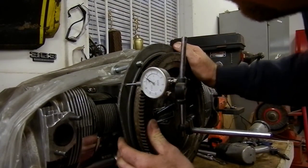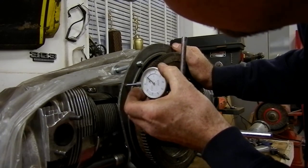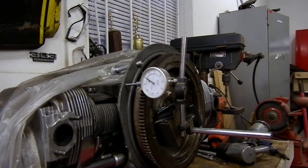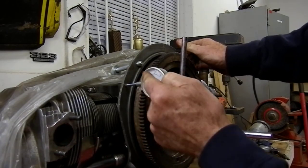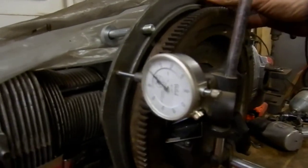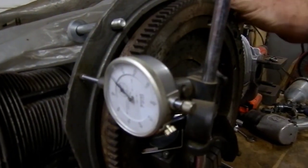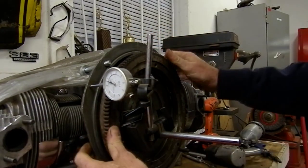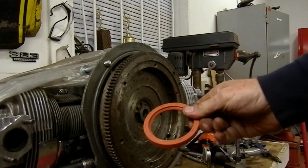I'd mentioned in class that I had done this and said I wished I had a camera, so here I am redoing it just to show what I found. It was textbook — the clearances I set the engine up for worked out exactly as intended. I wanted three to five thou of end float, and I'm at three thou. Before, we were moving all the way to 33 thou; now with the three 10-thou shims installed, I have exactly three thou of end float — exactly what I want for this performance engine.